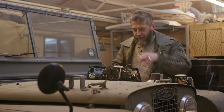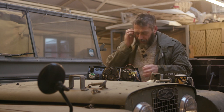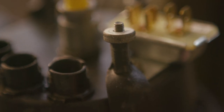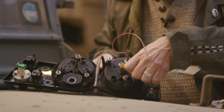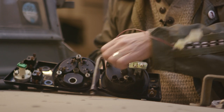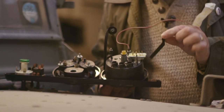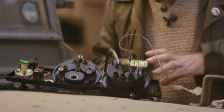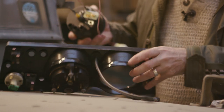Well, these instrument dials — the dial clusters. That's a dial cluster. They're held on with these little towers with an arm on it and a screw on the top. So I'll take out the speedo — just undo those like this. A little screw there. A little screw there. And there are these little arms which just attach over the screws. This one has a little locking washer on it, and then the whole thing just drops out the front. Same applies to the other one.